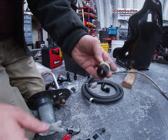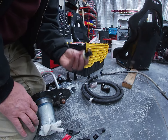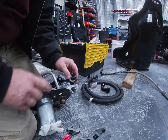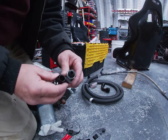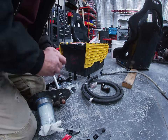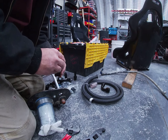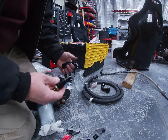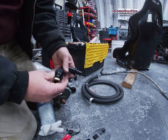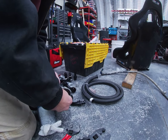So there's the ball valve. You can see a little ball in there, if you can see it. Now I would leave this in there as another level of protection, but it's so small. This is a number 8, and I want to increase it to a 12 so it can flow more, let more air escape. We can fill the tank faster. So I have this one here that I'm gonna install, and then I'll put a 90 on it, and then the hose will hook to this. But I think I'm gonna have to trim that out, yeah.